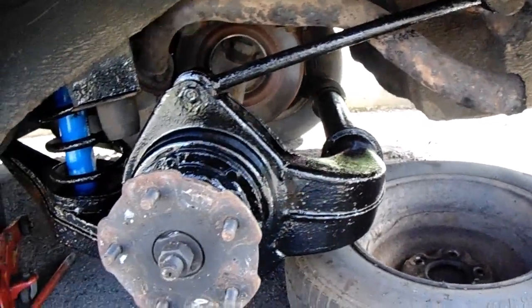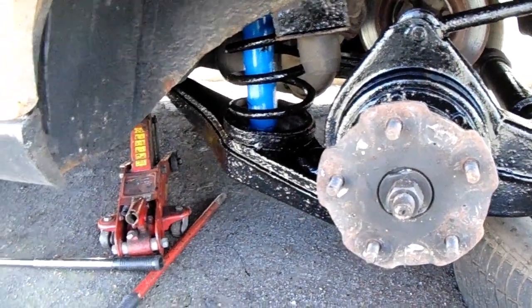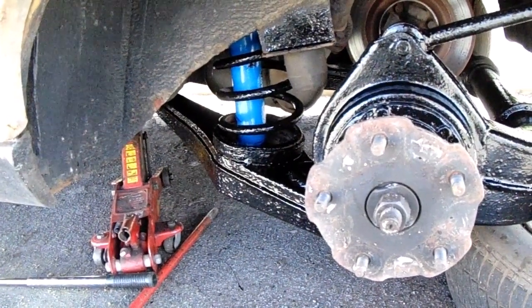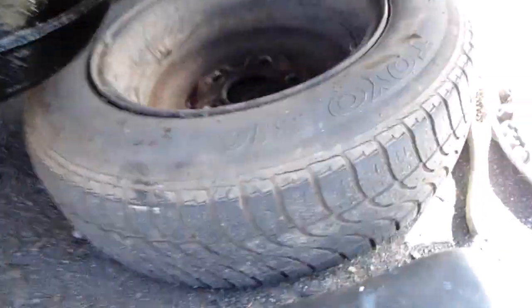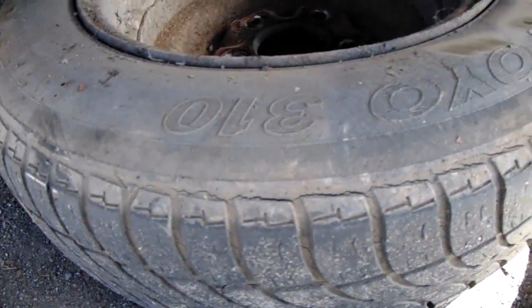And you could tell this car hasn't been on the road for a very long time. I'm out with spider webs and God knows what else was lying around under the car. Yeah, so you can see it hasn't been used for a long time. That's why the tyres are all shot, really. You can see where they've been flattened when they did pump air into them. I mean, you look at this tyre here. I don't know if you'll pick that up, but look at that. Cracks all the way around there. That is bad, isn't it?